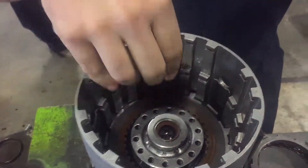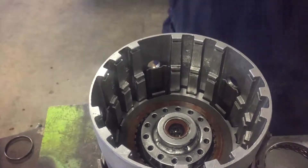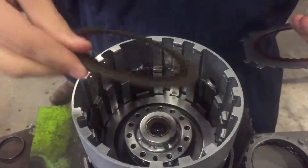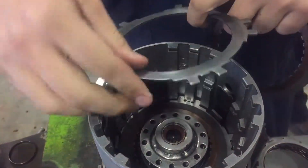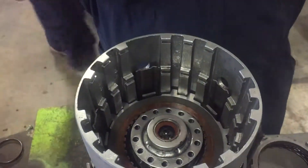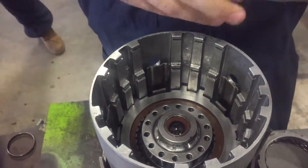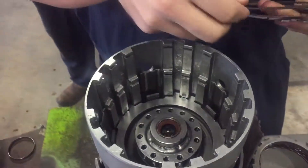The footage of the inspection of the discs got lost somehow, so I'm just going to try and explain as best I can. With friction discs, inspecting-wise, make sure the material is not all torn up or burnt — any kind of gouging, bends, or cracks. Same with the steel plates: there could be evidence of heat damage or cracks on the teeth. We'll just do an overall inspection.